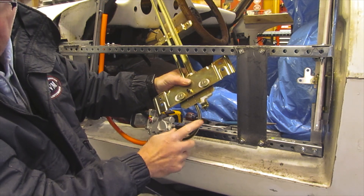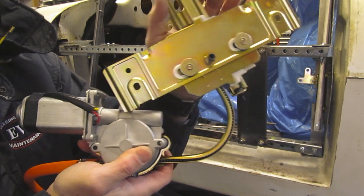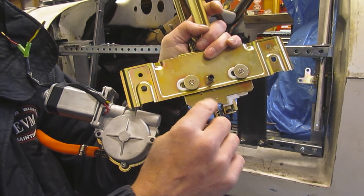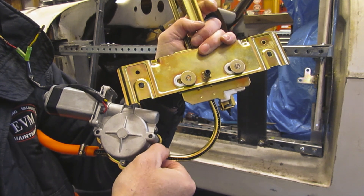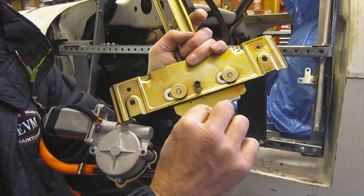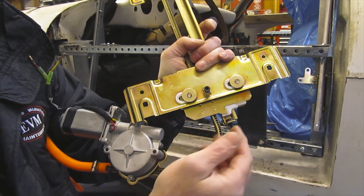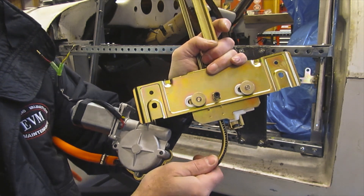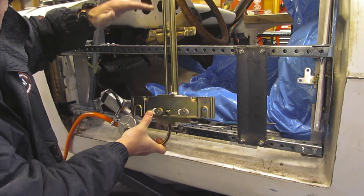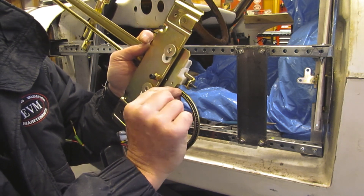The only issue I have is down here at the bottom with this type of regulator — this solid tube here fixes the motor position. You can get these with a flex tube through here; maybe that would have worked better in this case, but this is the one I got. What I ended up doing on the other side was carefully bending this tighter — a little tighter radius — to move the motor over and re-bend it so I can fit it lower in the door. Because if I don't, I won't have enough room to bring the glass down and hide it in the door. So I'm going to carefully bend this to a tighter radius.